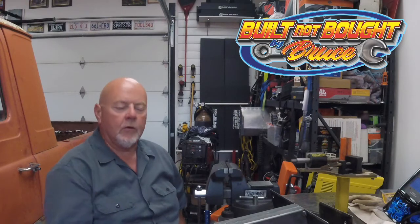Will that work forever? No. But it'll work for the rest of my life, and I'm guessing it would be decades before there would be any kind of issue with it. My plan for putting this back in is to use a lot of undercoating, make sure everything's covered. And this is part of why I made this a bolt-in piece — once these are welded onto the springs we'll roll the rear end under, lower the truck down, bring these up into position, get them on the frame, and then all we have to do is put the bolts in and tighten them up.